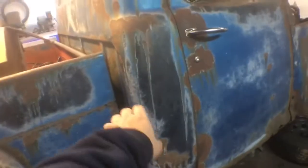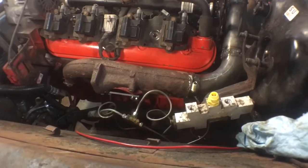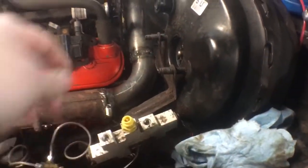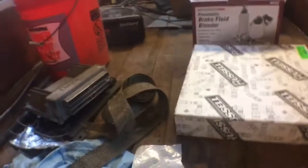They're probably going to end at the back of the cab somewhere. I'd like to put a muffler in wherever there's room — like a two-to-one and then just a turndown back here somewhere. Nothing crazy, just something simple. I don't think it'll be permanent, just something quiet enough to take it down the road. I also tested the spark plug wires — I need to see if they make heat shields for them; otherwise I'm going to make heat shields. The wire slips through here on the back three cylinders and that works perfectly fine. Once I get the flange welded on there, that'll be the last time it has to come out, so I'm going to header-wrap it. I have a little bit of header wrap left over from the V8 in this car — it has long tubes all the way back and they're header-wrapped pretty good — so this is just the excess to keep it cool.